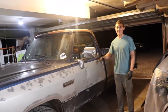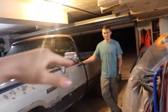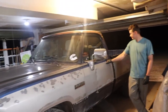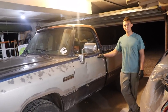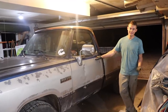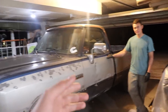Just to be clear - when he says his application is backing onto algae-coated ramps, he needs four-wheel drive. For day-to-day use the two-wheel drive is not a problem, but some of these lakes they travel to are five hours away, steep, and just covered in algae. There's nothing you can do about it unless you have your front tires on dry pavement pulling you out. So he's got the starter in now.